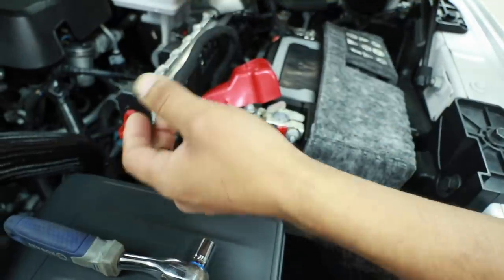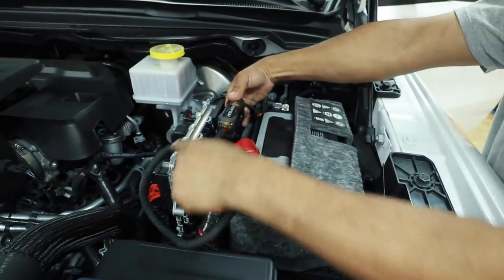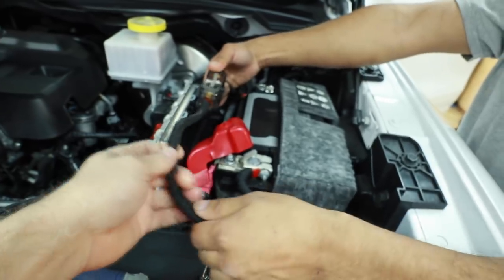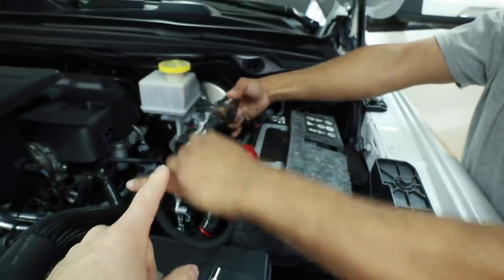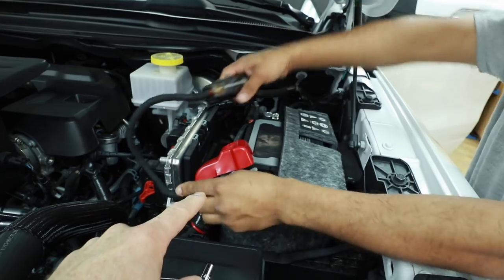Getting back to the battery — it seems okay, but not really. This fuse wire run is too long. They could actually mount the fuse right here and avoid this extra wire pretzel. The other question is that's a four gauge — and that's the only fuse holder. So right now we're running four gauge for three amplifiers. Once we get those three amps out, we'll do some math and figure out the amperage draws, the wire length, and whether four gauge is adequate or if we need two four gauges or all the way up to zero gauge. I'm thinking we'll get at least zero gauge.